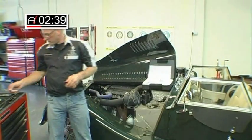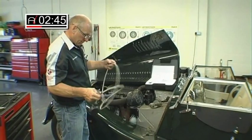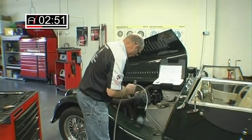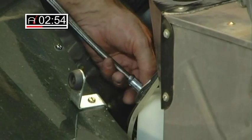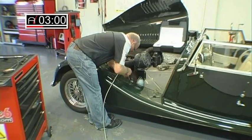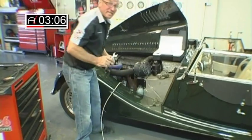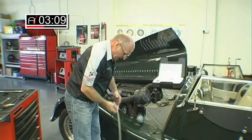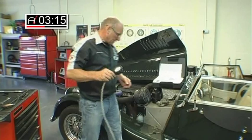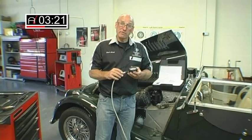This doesn't have to be particularly tight, although obviously absent of any leakage, because that will affect the pressure reading. We've actually conducted some tests on the open road, and interestingly what we found was that the maximum load or pressure was actually at the lower end of the engine speed range but with a very high throttle setting — pulling away from a junction in second gear at about 2,000 RPM — and that was on the diesel engine. As I say, we're doing some development work with Clarius in order to prepare a process procedure for diagnosing DPF and catalyst-related problems.